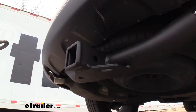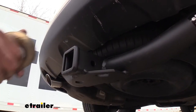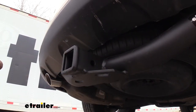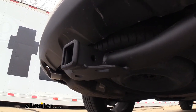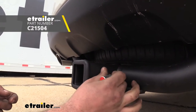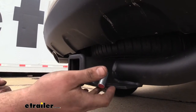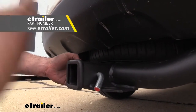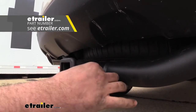On the bottom here you're going to see plate style safety chain loops, and that's going to be great for hooking up your standard hooks or even a larger clevis style, which can fit pretty easily on here. Another thing you're going to want to look at is the actual hitch pin hole — the hitch pin and clip does not actually come with the hitch. This is going to be a 5/8 inch, and if you wanted to get a locking one to lock your accessories in place and make sure they don't walk away, we actually have locking ones available here at eTrailer.